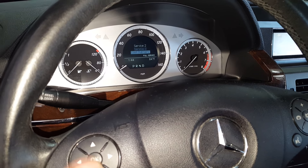So I confirmed it. Basically from that point you can go to Service Data and it will tell you right here I have a year on the clock and also 10,000 miles. So I shouldn't see any messages until I hit a year from now or 10,000 miles from now. To confirm that it worked, you can just turn it off and start your car and you won't see any sort of service message after that.